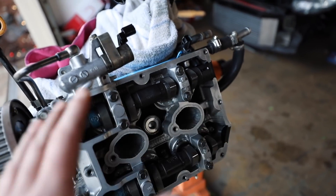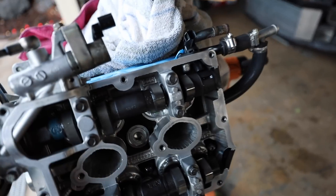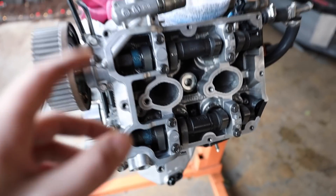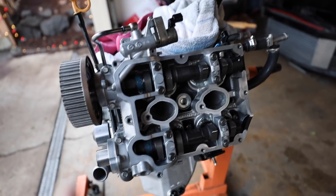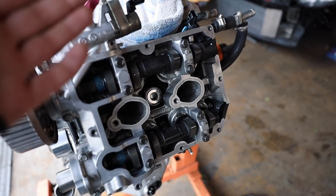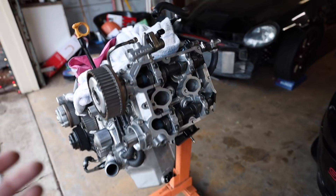I've ordered a 478 bucket with 2-day shipping. I'm not going to bother taking everything apart again until it arrives. Make sure you lube all the cam lobes when going through this. Yes, 0.004 is better than before, but it's not the spec we need and it will affect how often and when the valve actually opens. I want to be super comfortable with it before it goes back in the car.